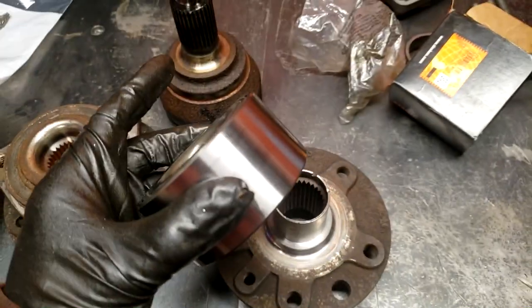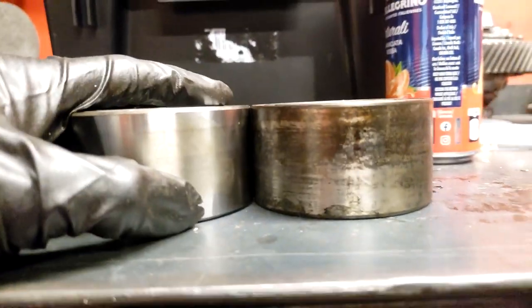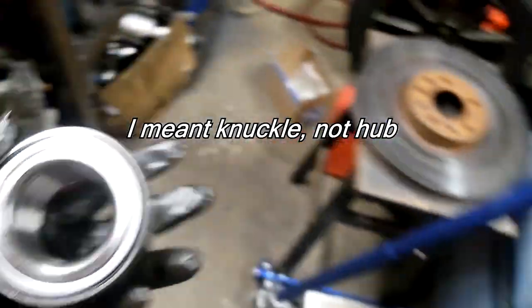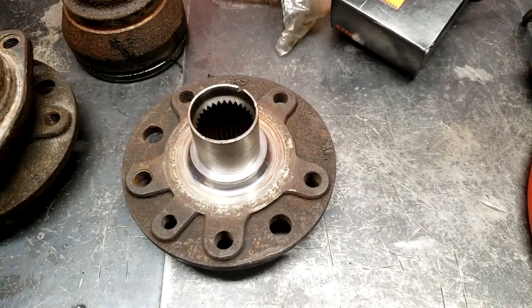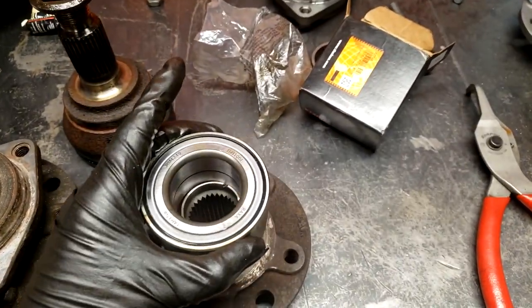These are Timken SET 49 wheel bearings. So you can see these are larger inner diameter. These are actually 42 mil ID. But they're the same height as the 900 wheel bearing, but they're actually 2 millimeters larger in diameter. So it doesn't actually fit into the hub. So before I get to the hub, now I can actually use these wheel bearings and then machine a hub to 42 instead of 39, because they'll give it enough material and then make it work.